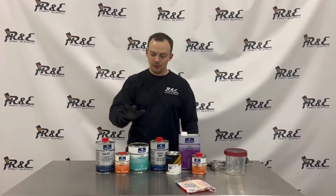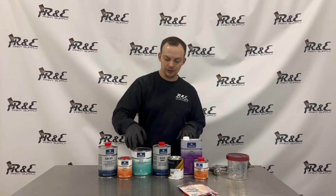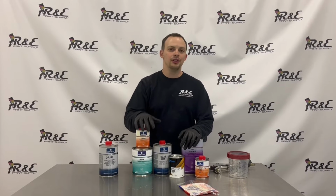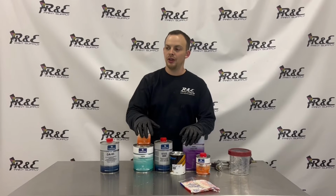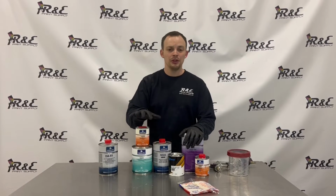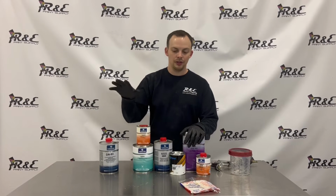Already wiped our hood down. We're getting ready to apply primer, and in this case we're going to use Roberlo Repox, which is a 3-to-1 high build epoxy primer. The reason we're using this is we have a lot of bare steel exposed. If we had a lot less exposed bare steel and it wasn't on the front of a hood, we'd probably use Roberlo Multi-Seal, which we'll also attach in the link below.